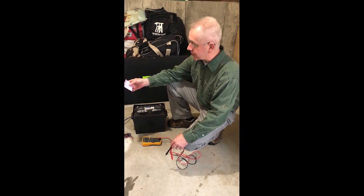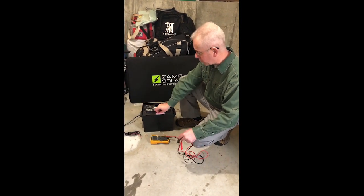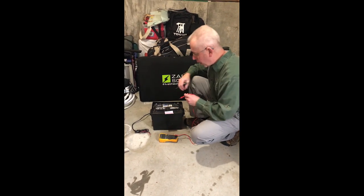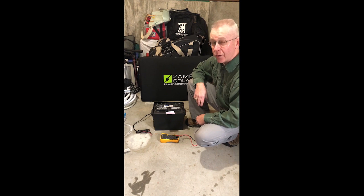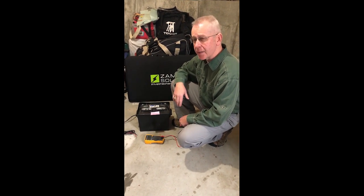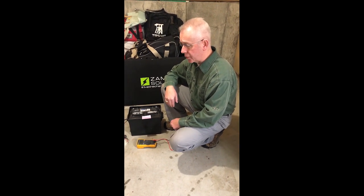We winterized on 8th December and at the time the battery read 12.64 volts. We're just going to do a quick check to see where it's at right now — 12.51. That's about 0.13 volt loss over the course of 40-something days, which is about 10%. The battery is holding charge well, and you just want to make sure it's doing that.